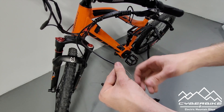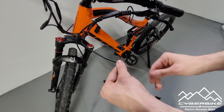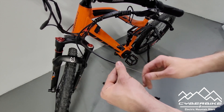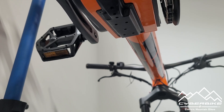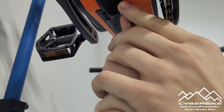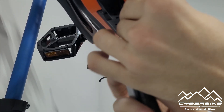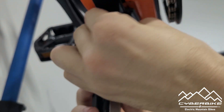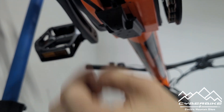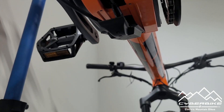After you've reinserted the cable into the housing, just let the lever gently hang there — we need it removed from the handlebar for the next few steps. After you've reinserted your cable, go ahead and go to the bottom of your bike and remove these two screws. Be sure not to lose them. Removing these two screws will give you access to the bottom of the cable holder and make the cable a lot easier to slide in and out.